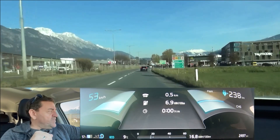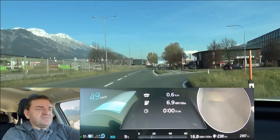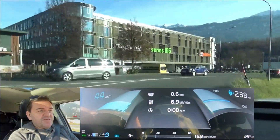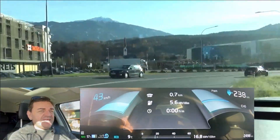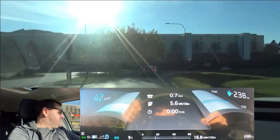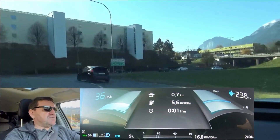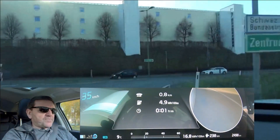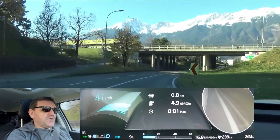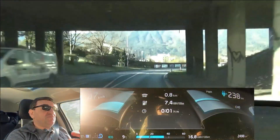Don't misunderstand me — you can also coast in one-pedal drive mode and regenerate much energy when automatic regeneration is turned off. So this is a comparison between driving styles and not drive modes. Although experience shows that in most cases drive modes and driving style go hand in hand. I think the reason for that is that in one-pedal drive mode it's rather difficult to find the point where you are neither pulling energy nor regenerating, whereas in coast mode you just take the foot off the accelerator and the car is coasting.